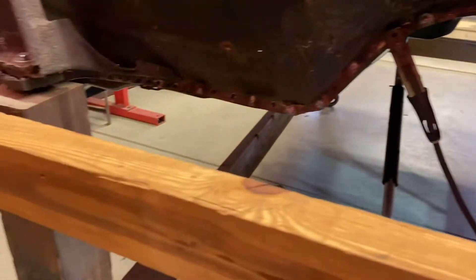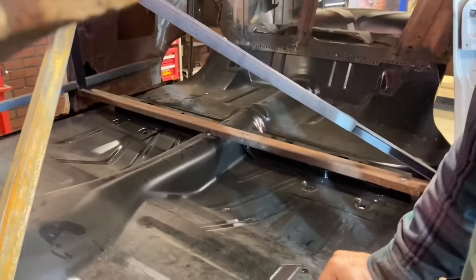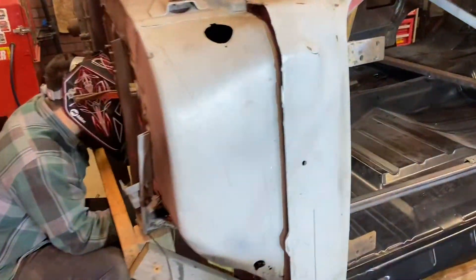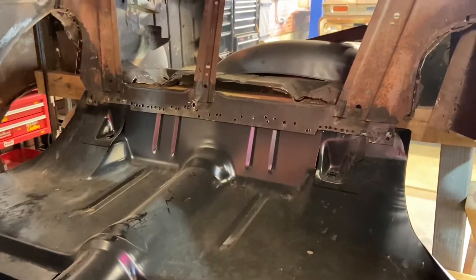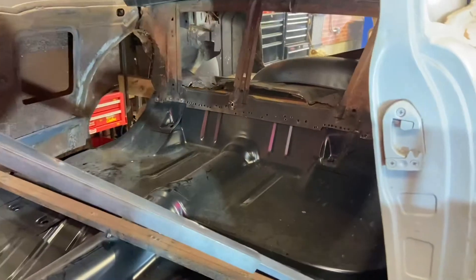We've got a whole lot of heating and beating to fill them spot welds. What do you think, Dad? You happy with it? Yeah, overall this old floor fit pretty good. Lined up nice — everything lined up with the way you had the body braced up from the old floor. Pretty tight seams in there. So Dad's going to finish putting the spot welds on the front so we can climb in here, press on the old metal to get it to lay flush on the new metal, and then spot weld the rest in the back.